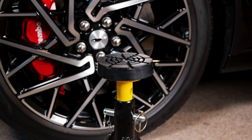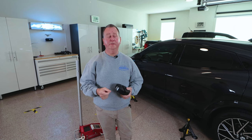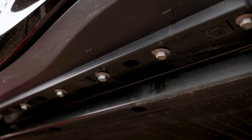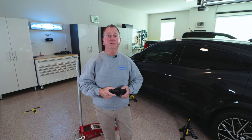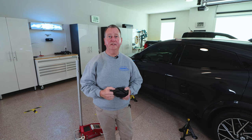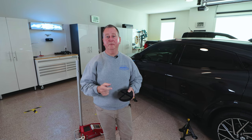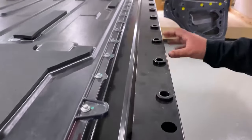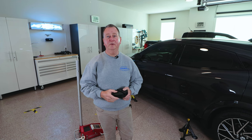The Mach-E Mustang has four lifting points at the four corners of the car. If you have a lift, that is a great thing — most of us don't. The concern for me was where to jack up the car to place the jack stands underneath. Doing some research, I found that the perimeter frame around the battery, which is aluminum, is what Ford wants you to jack on in the normal locations.